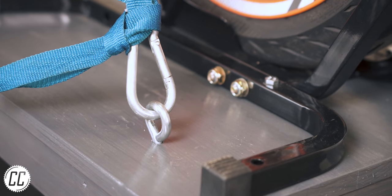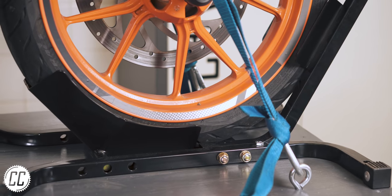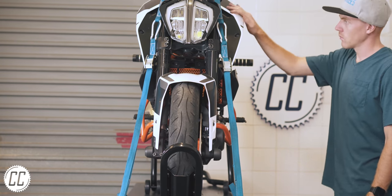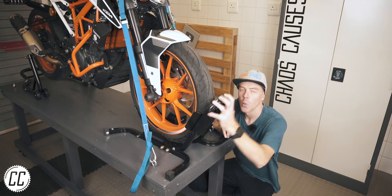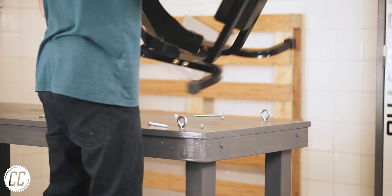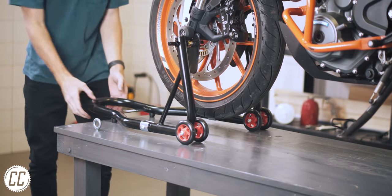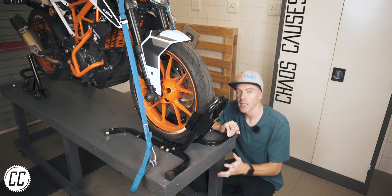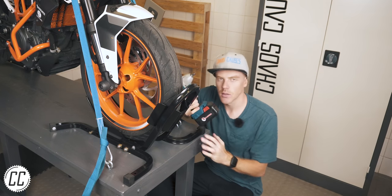Wider tie-down points would be more secure, but this is the best place I could mount these and it actually works really well. It's not like transporting your bike where tie-downs need to be super tight — it's more like a catch net to prevent your bike from tipping over, and usually it doesn't even compress the suspension. Originally I wanted to use wing nuts to fasten the wheel chock down so I could quickly remove it with just my fingers, for example to replace it with a paddock stand for a tire change, but I settled on regular nuts — and the truth is an impact driver is probably faster than my fingers anyway.